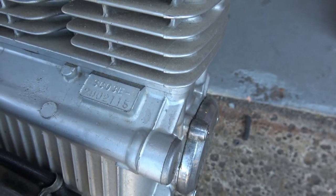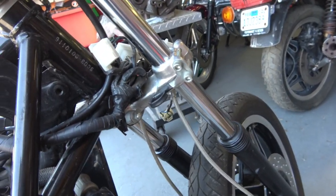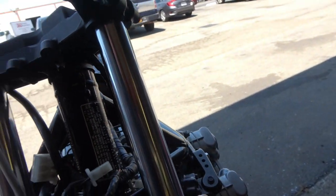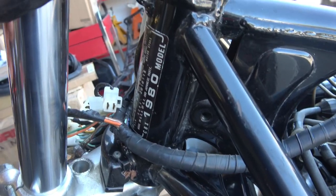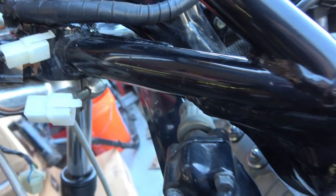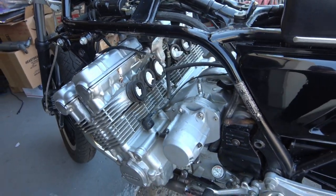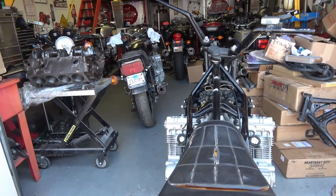First of all, the Marysville bike has VIN numbers that are a little bit different — the engine number is off about 1,700 numbers from the actual VIN on the bike. That's one unique thing about the Marysville bike. This right here is the Marysville bike, so as you can see the engine numbers are off about 1,700 or so. Also, the Marysville bike has a number one in the fifth position from the end on their VIN — that's one thing that's different on the Marysville bikes.